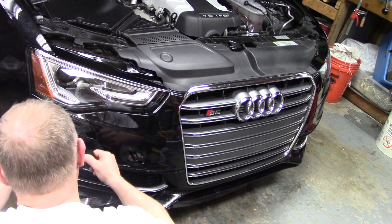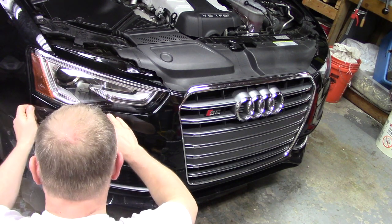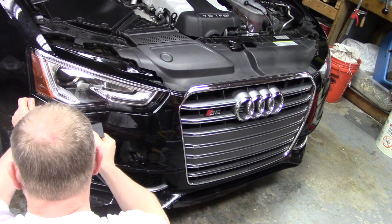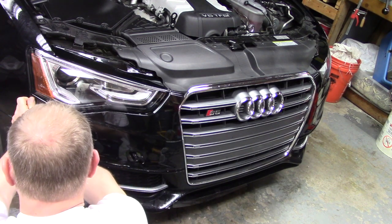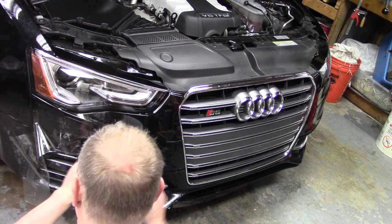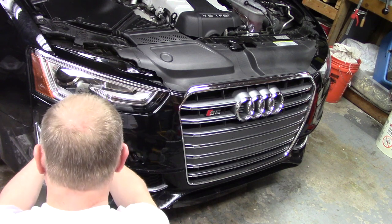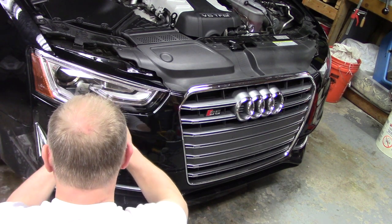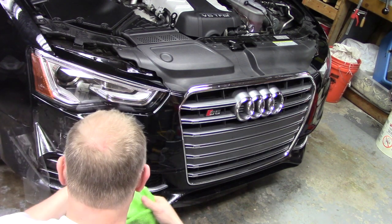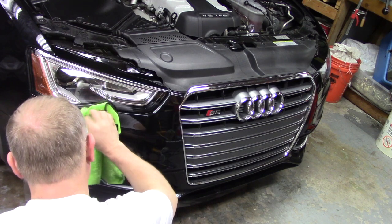All right, I'm starting to ride up a little bit high here, so I want to make sure it comes back down. All right, this is another area where I've got 3 different planes coming together right here on this spot, and it's wanting the film to pull away, and I can squeegee this all day to my heart's content, but the water keeps wanting to run back down in there, the solution. So I'm going to have to come in here with the towel so that as I push it, the towel absorbs the excess solution and it will stick.